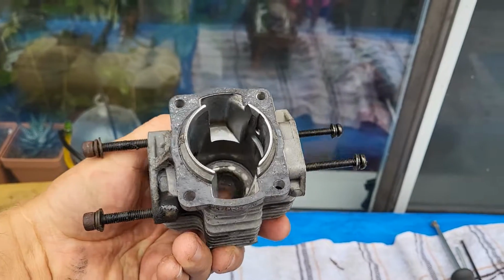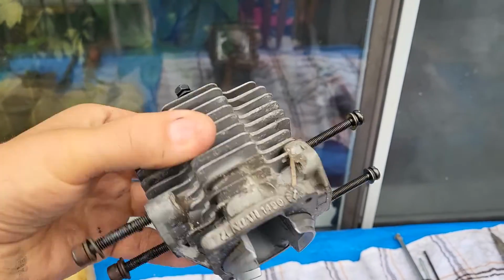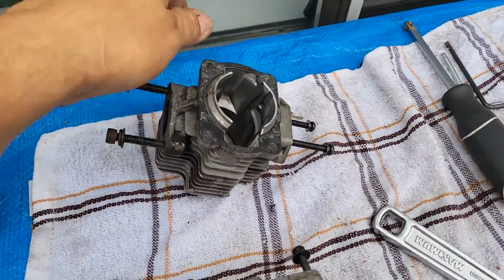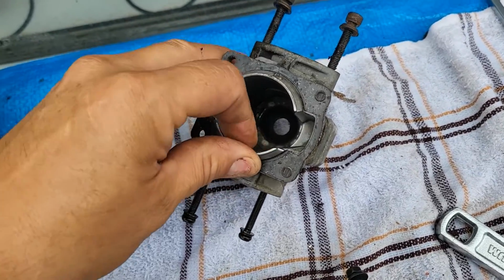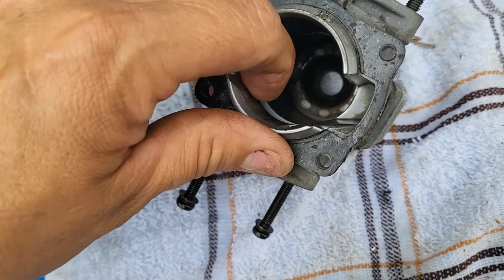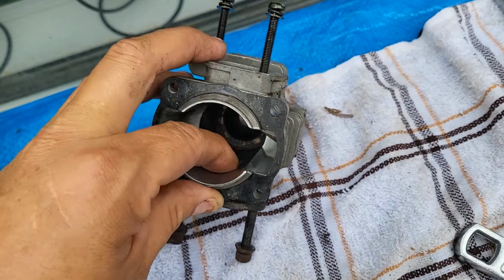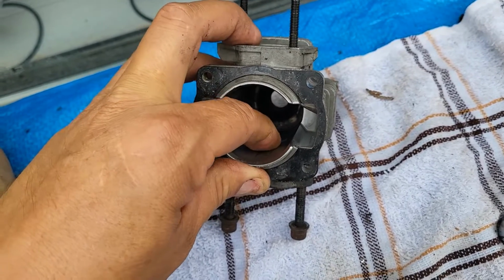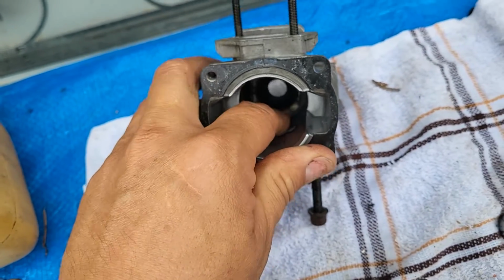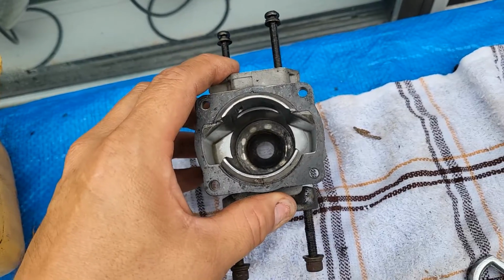When you look at every place else around it, it's nice and clean and tidy. There's no damage outside anywhere else of the cylinder. It's just right there. Now when I feel around there, there are no rough grooves. That part in there is still smooth. There's nothing that is sharp. It's not abrasive. There's a slight wear right here in the middle, but when I go up here I can feel it. Yeah, this is not the first time I've stuck my finger into a nice hole.